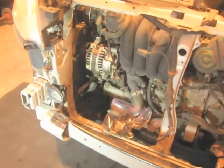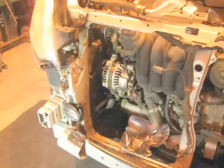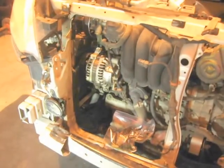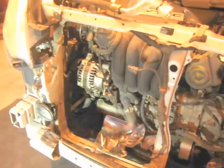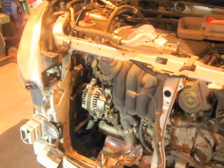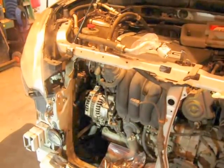I think that between the cost of the compressor, the new filter for the accumulator dryer on this particular model, and a whole bunch of new pins or plastic clips or what have you, I was right around $200 for that. I also went ahead and ordered a belt and a tensioner and some other stuff too while I have this thing torn apart. But the last quote I got from the mechanic was $1,300 to do this job. And I'd say for probably $350, you can more than do it.